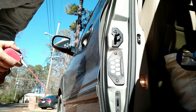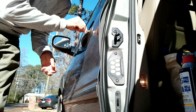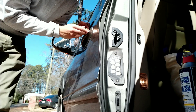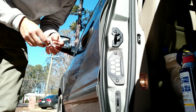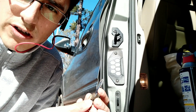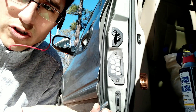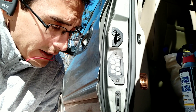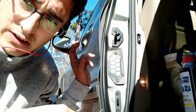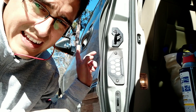First you're going to spray the door lock with WD-40, then stick this key in just to spread that lubricant all over the tumblers. Now this comes the important part of reading it. Like I said, there are only six pins maximum that you can read from a door on a Ford. You have to know this before starting. There's a total of eight cuts on a key, but the door doesn't need that many — they only have six, sometimes even five. The majority of times you'll see five cuts only on the door and eight on the ignition.